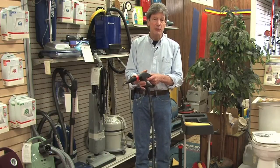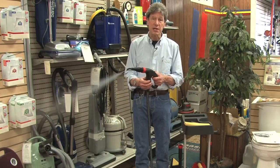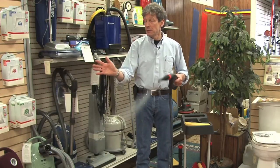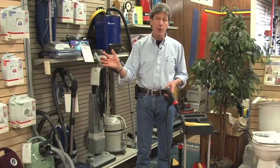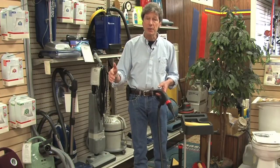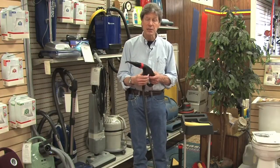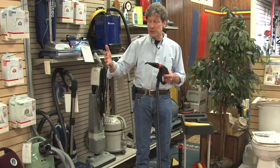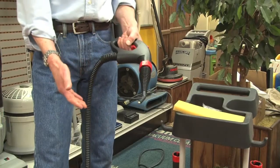We have steam levels available, and when I pull the trigger, the product produces the steam. They call it dry steam. You can see that looking at my hand, it's basically dry. The amount of water in this steam content is extremely low. Now right here is a little over 200 degrees, so lest any think that it's the same coolness throughout the steam plume. It's not. As you approach the nozzle, the temperature rapidly heats up.